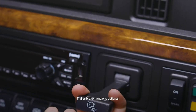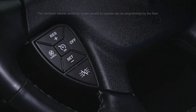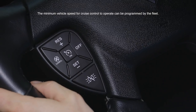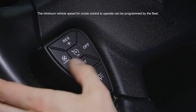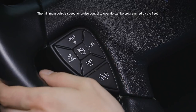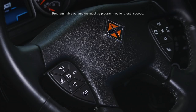To activate the trailer brakes, pull the optional trailer brake handle. There may be an optional feature to keep the trailer brake applied. To activate cruise control, press the ON button. Typically, cruise control will only activate above 35 mph. Press SET to set vehicle speed. Press the plus and minus to accelerate and decelerate. If you apply the brake, cruise control will remember the set speed. Press RES to resume your previous speed. Press OFF to turn off cruise control. Cruise control can be used to increase engine speed with the vehicle parked, which can charge batteries or fill air tanks faster.